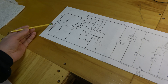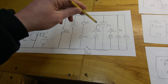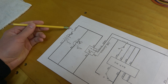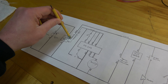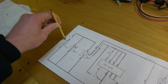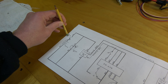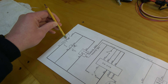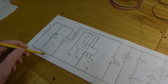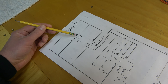In general we're going to have the battery, a charge port, and two circuits. Circuit one is in charge of the headlight and circuit two is in charge of the auxiliaries. We're going to have the battery coming up to a fuse at 15 amps - since the Thunderbox can supply 16 amps to each circuit and the main connector uses 18-gauge wire which is only rated for 16 amps at 12 volts, 15 amps is a safe choice. The headlight is going to draw about 3.3 amps.